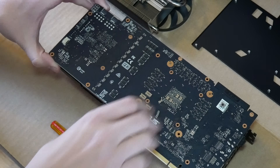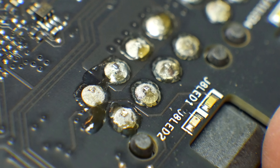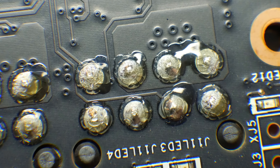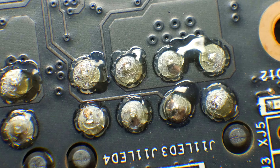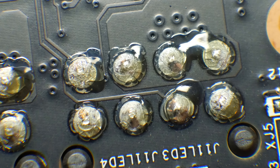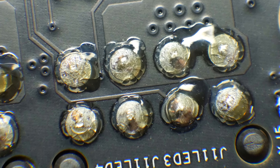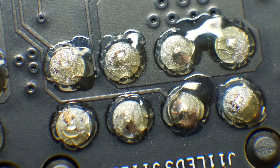We finally have a good look at the through pins and solder connections for those power connectors. The solder looks a little funny and it's a bit of a strange color, though there's nothing too obviously wrong with it. Also, this yellow material, which I initially thought was flux, appears to be some sort of epoxy resin. Whatever it is, it is pretty cracked, which could indicate movement from those connections.